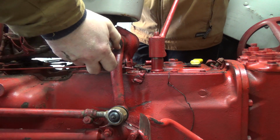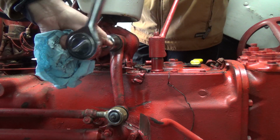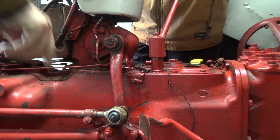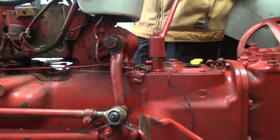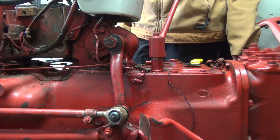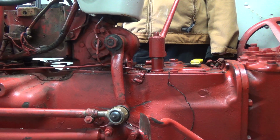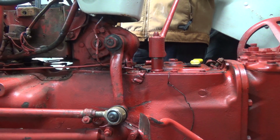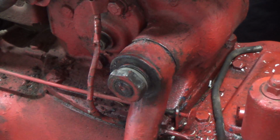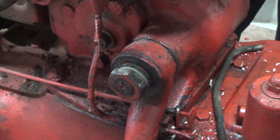I don't know. Not a good thing. Need something in behind. That taper, I think, is gone, because what that's going to do now is eat into the side of the tractor. Yeah, there's something wrong in that thing, because it's still moving the way it was before. Oh, yeah. Yep, she's worn out. I'll show you where she's moving real bad here. Okay, this is moving the steering wheel, so there's a pile of play in it there still. I think that taper's gone.